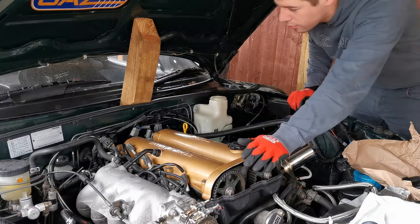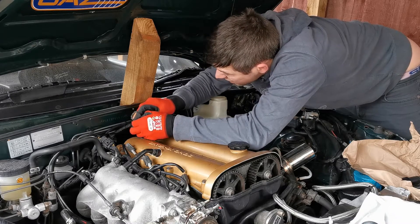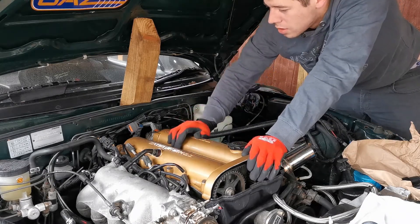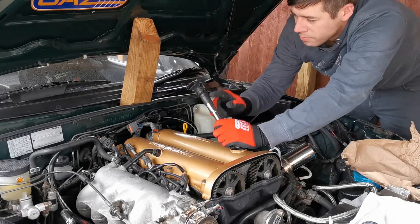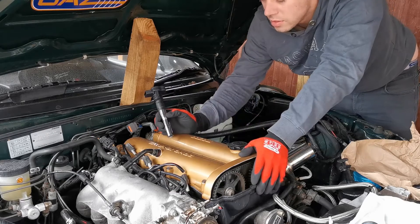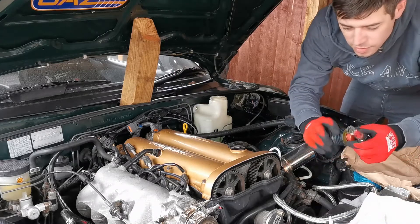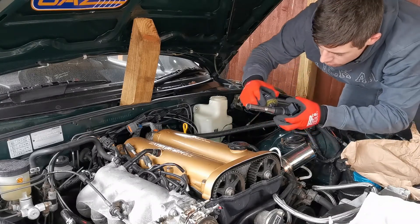There are two questions Alex wants to know when you order the kit: how many cables are in the plug — on my year MX-5 Mark 1, there are three, though they all use a four-pin plug — and the opening size of the spark plug holes. They're about 26mm, but Alex sleeves them as accurately as he can, around 25.5 to 25.6mm. Mine averaged 25.8mm so they all fit really nicely. Rattling around is what kills these coils.